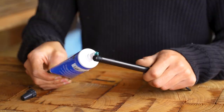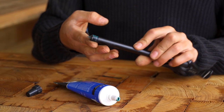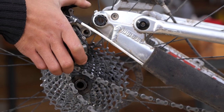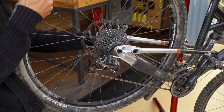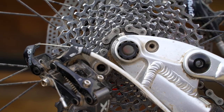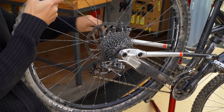When you're done with your work and it's time to reinstall the wheel, add a thin film of grease to the threads on the axle. Get the derailleur out of the way by pulling it down and back. It also helps to make sure one of the smallest cogs bumps up against the upper section of chain. Check that the wheel is fully seated in the dropouts before reinstalling the axle. If the axle doesn't slide in smoothly on the first try, remove it and check the wheel's alignment before trying again.